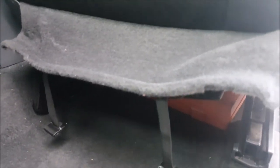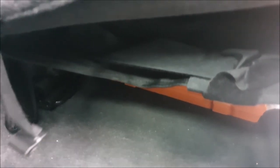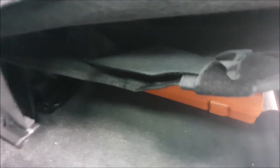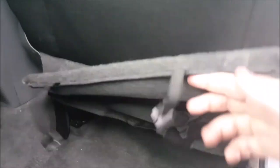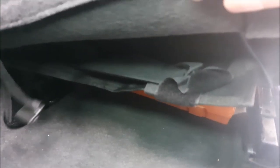What I was referring to at the back of the seat is this actual flap that's standard on the Ranger. These little ties go down underneath the seat and hook in up here to keep it all taut. The problem with that is when you're trying to feed a seat cover through the front between the two, this covers it up. You can see that's the actual Black Duck cover under here. That's why you need to do the base on these first, because otherwise you won't be able to get to this for the base. These sections here run underneath the seat — just something to be wary of if you're fitting these into a Ranger. I did the passenger side first going from top to bottom and found myself stuck trying to get this off, which meant I had to take the top off. Do the base first — that's why.